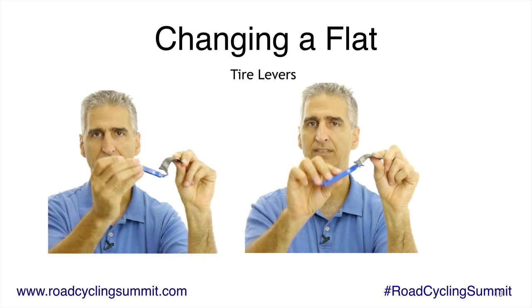Here's a picture. Sorry, I'm in the picture here. I didn't want to have that, but I'm showing how you use a tire lever. You see the picture on the left? When you take a tire off, that's a little slice of a tire. See that little spoon side of the lever? It hooks under the bead of the tire, and that's what you use to take the tire off. On the right side, I'm holding the tire lever with the little spoon facing the other direction, and that's when you're putting the tire back on. That's important to know when you're using these levers.